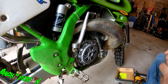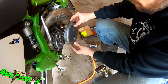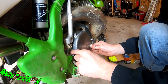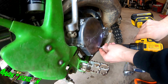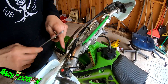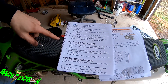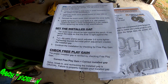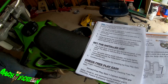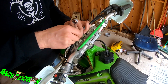All we've got to do now is put the clutch cover back on. There's a little pin there — just make sure it stays and that the gasket doesn't move. I turned the cable adjuster all the way in and the perch adjuster all the way in until I had a little bit of gap. According to the instructions, the clutch should be tight against the perch. If not, adjust so the lever is tight, then turn the cable or perch adjuster three to five turns tighter. That's where we're at — now I should be able to start the bike up, let it warm up, and check for free play.